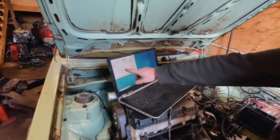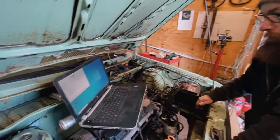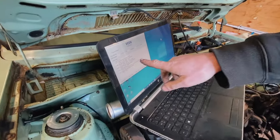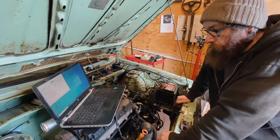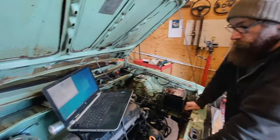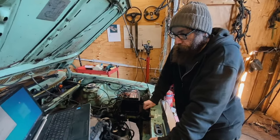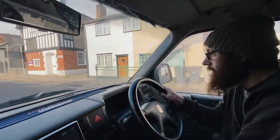See, the manifold intake temperature and manifold pressure sensor, that'd be the map sensor, basically. And that's just because it isn't connected. Oh, and the throttle pedal's not connected either at the moment. Or the pedal. The wiring's there. I've started doing the wiring for that, but the actual pedal's not connected. Sweet, man. I suppose we better take another jerry can and go to a fuel station. Yeah, let's go and get some diesel, I think, is the answer. All right.